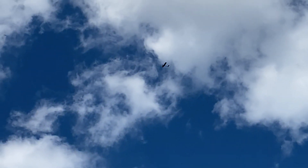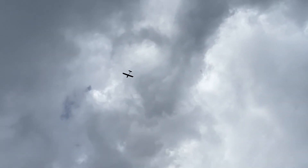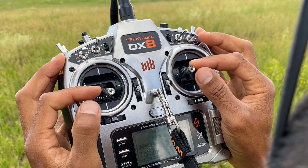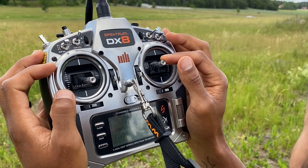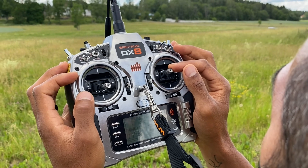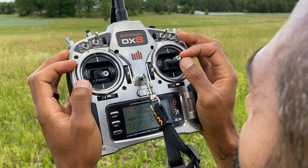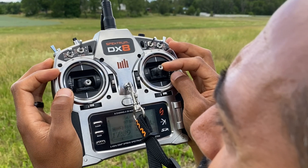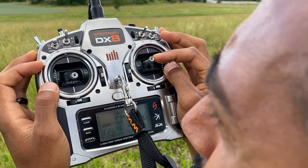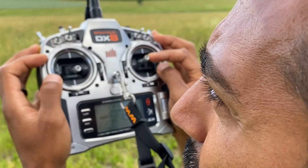We'll do an auto-tune because maybe things like how I've mounted it, maybe the accelerometer's not calibrated the same, maybe there are some things in the setup we've done differently. So let's do the auto-tune again. We're sort of cruising around — maybe this is 30-40% of the way it's set. We'll have to look in the OSD to see what it is. It's flying quite smooth and quite nice. It wants to turn right, so let's auto-tune it and see if we need to recalibrate the accelerometer again.